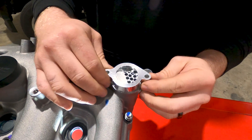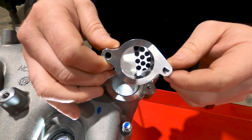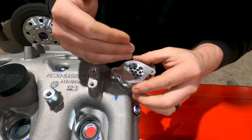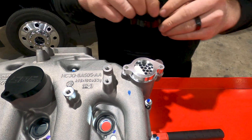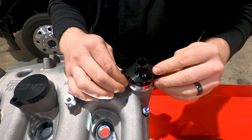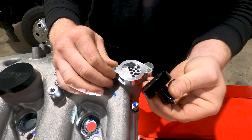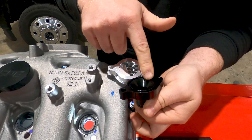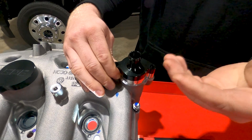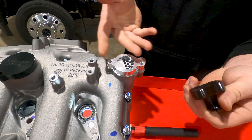Also on the top of the baffle, there is a notch as well. If anything builds up on the floor, it can drain back — because obviously the valve cover mounted on the engine is going to be at an angle, so everything is going to want to move that direction. Then your standard hose adapter goes on top of the internal catch can. That's all designed to work together, and it's designed to work very well with our system. You can also use it with other crankcase systems that retain the bolt pattern.